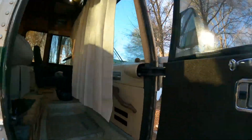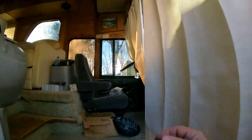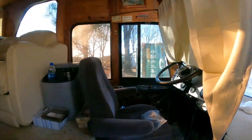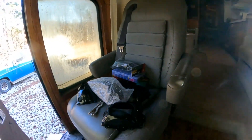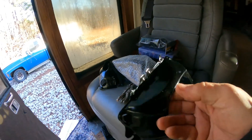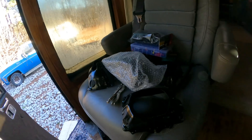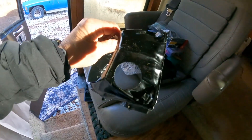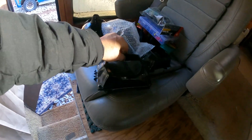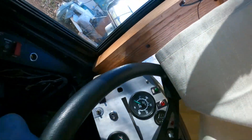Here is El Busso, and it has the curtain up right now. Here's one of the headlights sitting right here, and that's going to go back over here. There's the headlight buckets right there. What I did was I went to a salvage yard and found these out of a GMC pickup and they were the right size. Had to do a little modifying on them — had to cut a hole in them. There's a protrusion on the side of the LED headlights and had to make provisions for that.